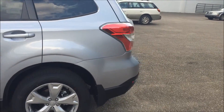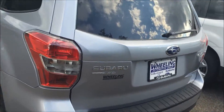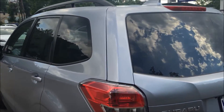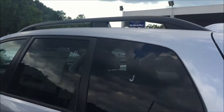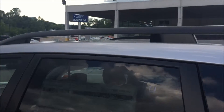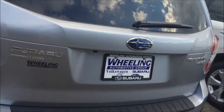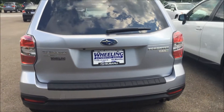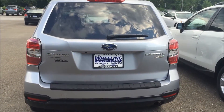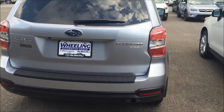The quarter panels have great access. And it is an SUV, which brings up the question of roof damage. If you do have damage on the roof, oftentimes, just like with cars, we'll have to pull the headliner. Also, these luggage racks can need to be removed, as well as sometimes the hatch. The good news is, with having to take extra parts apart, with all the modern technology and design, everything goes back together like it was never taken apart.